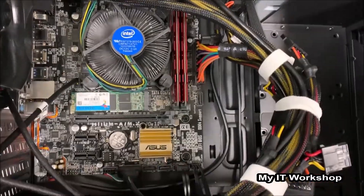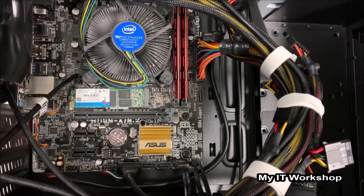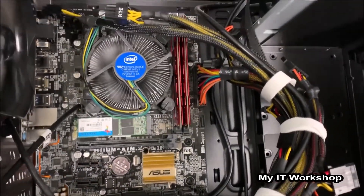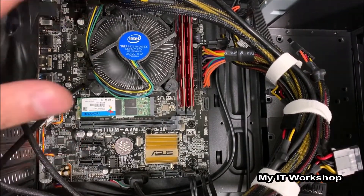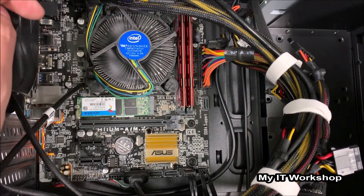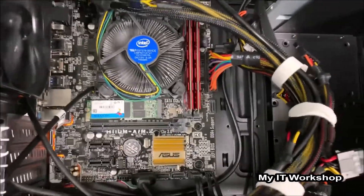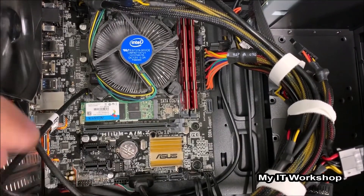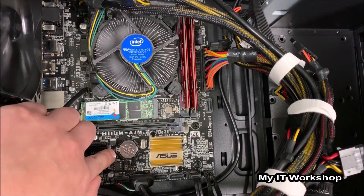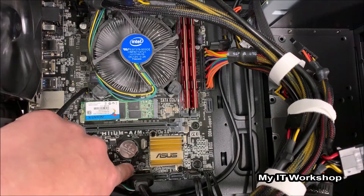If this process did not work, I advise you to try it two or three times. But if it still doesn't work, you have to take out the CMOS battery — you can see the battery right here. You can replace it; if you want to see how, I'll leave a link in the description below from another video where I do exactly that. It's really easy to take out and leave out for a few seconds.